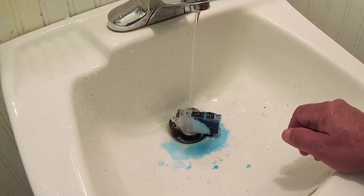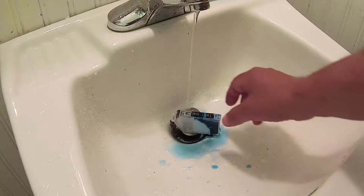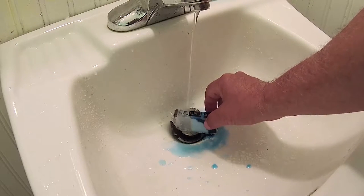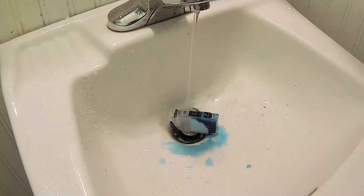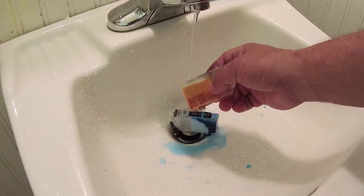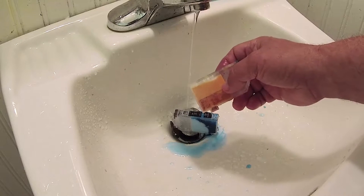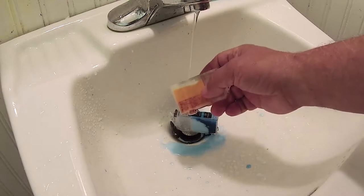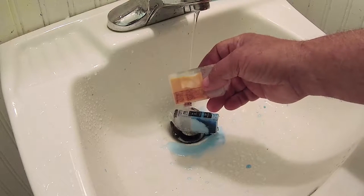The CLI-42 yellow is the one that gives everybody the 'yellow jello' problem — when you mix it with anything water-based, any ink that has a water-based liquid will tend to react with it. So what we need to do is dissolve away the ink that remains in the sponge with something that will dissolve it, and that seems to be Windex with ammonia, and also Piezo Flush from Inkjet Mall.